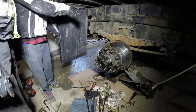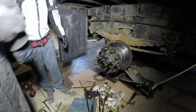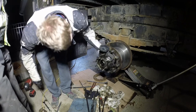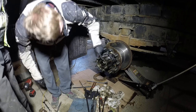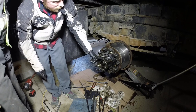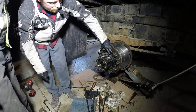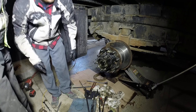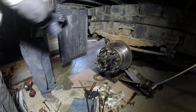You want to tilt the truck so the oil slides down the axle tube and fills the hub. You can also put the axle in and fill it through the drain hole — leave this bolt out, fill the cavity through there, and just make sure there's oil in there, otherwise it'll lock up.